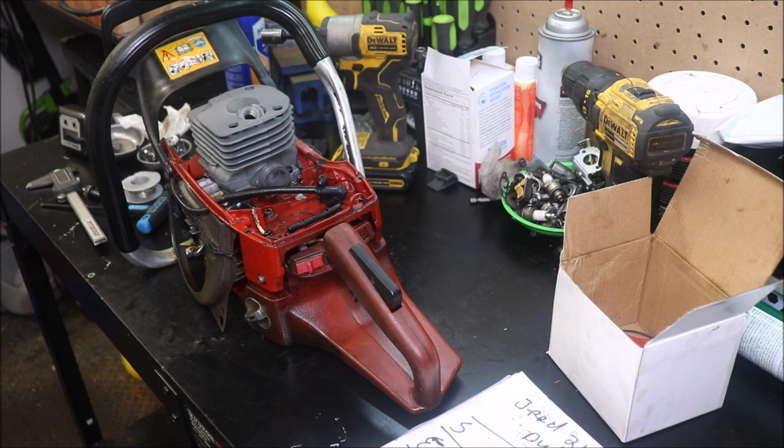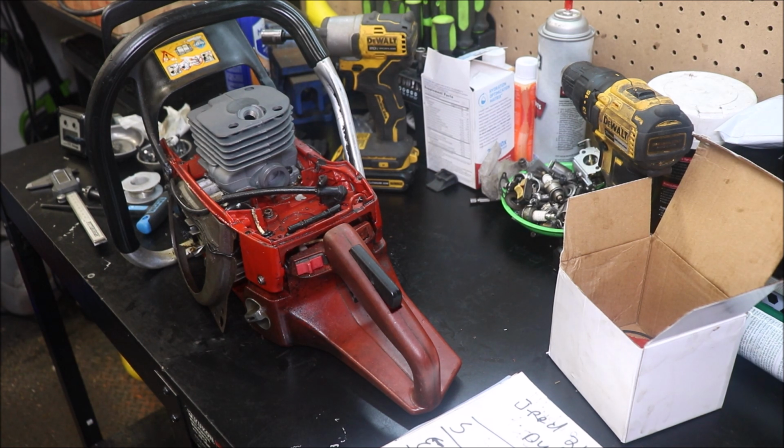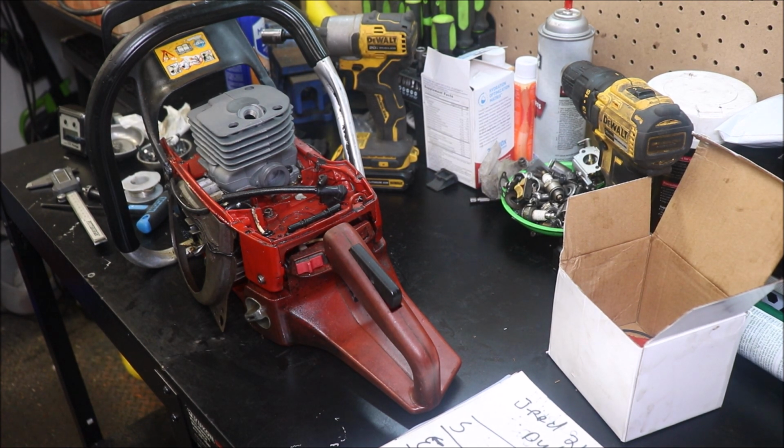We'll be doing machine work on this. I honestly plan on doing quite a bit of machine work. Depending on where the upper transfers fall, I'll kind of tell the tale on what I do. But that's pretty loose. I probably don't know that I would put a base gasket in. I guess you could. If you do, I'd make sure it's a thin one.